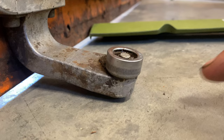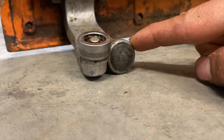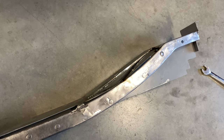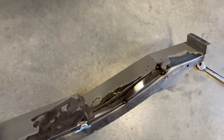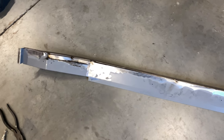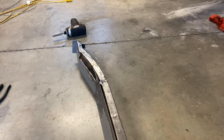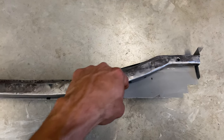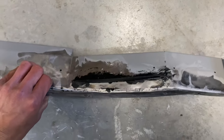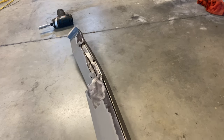If you look at the way the rollers are set up, the top roller only impacts about the upper inch, maybe half inch, of the top rail. The simplest way to put it is that the top roller guides the door and the bottom track is essentially just for the bottom roller to ride on. So if the back of the track where it's contacting the upper roller isn't guiding it around that curve right when it's getting towards the end where it's going to shut, the door would move in and out — which seemed like a problem to me as I wanted to work as close to factory as possible, which is why I did this bend.